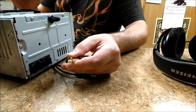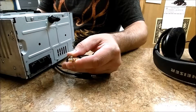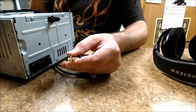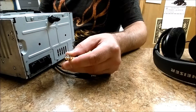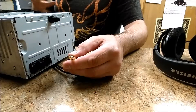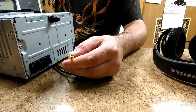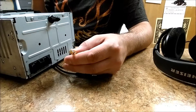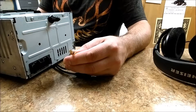Say the head unit maxes out at 50 on the volume scale. You're getting closer and closer — say you're at 47 — and the headphones don't sound right. The volume will still be low on the headphones, so make sure the outside noise around you is quiet. Do this in a garage or a quiet area. You're listening for the music to start breaking up and getting distorted — not sounding as clean as it did at lower volume. So if at 47 it starts to distort, back it out by 2 and drop it down to 45.